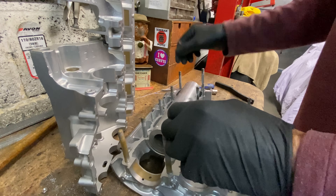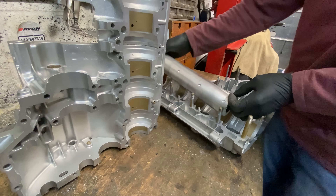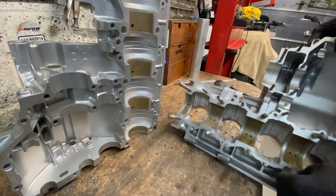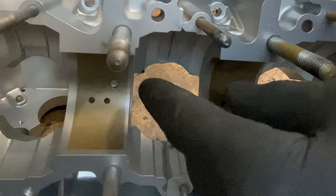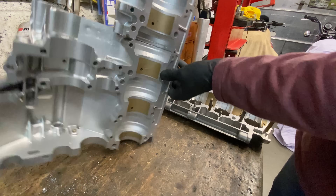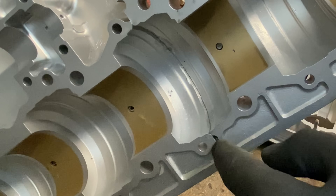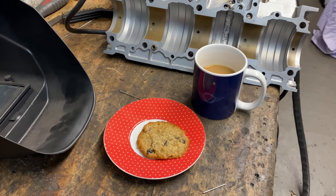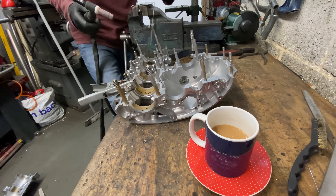If there are any dips or low points I can add more weld, but this is just perfect, so now I can split the crankcases to do the internal welds. The mandrel is a really tight fit in the main bearing journals — I have to give it a tap with a hammer to remove it. So now I'm all ready to do the internal welds. I hear a tap on the door — Tracy's brought me out a cup of tea and a cookie that looks so nice, so I'll just eat that first and then get straight on with the welding.